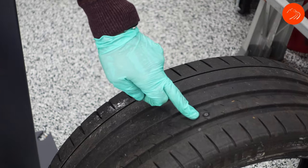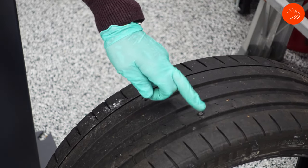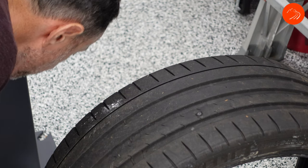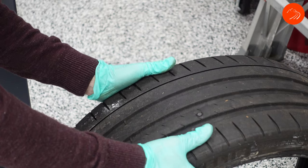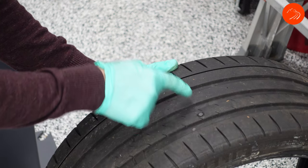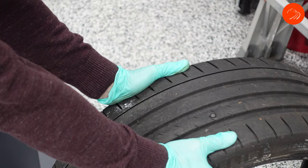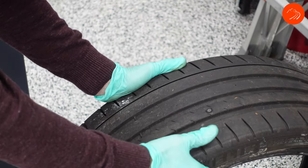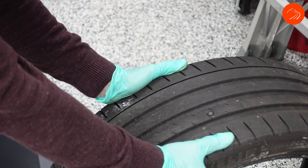We've done this repair and I've had guys drive another seven or eight hundred miles with that plug in their tire. As a reference, if you place your hand on the tire and lay your thumb on it, as long as the object is between your thumbs, you're good to use this as a tire repair kit. If you're at the thumbs or further outside, you'd need to get a new tire. Also note that if you have a bolt or a really large object, it may take a couple of plugs — I had a friend who had a bolt and we put in three plugs to fill the hole.